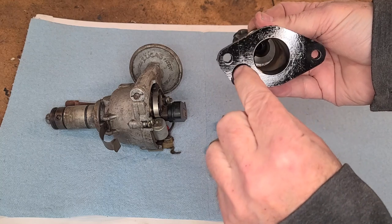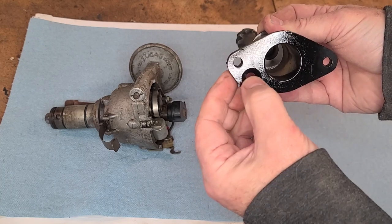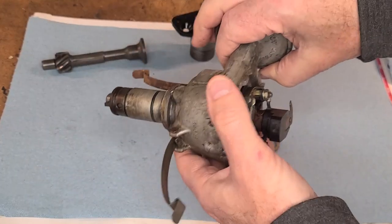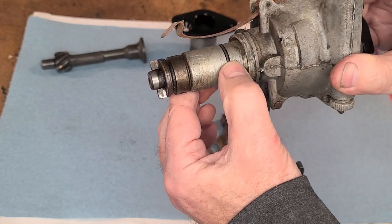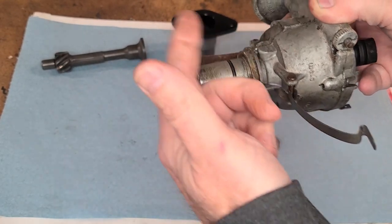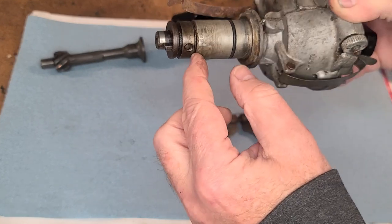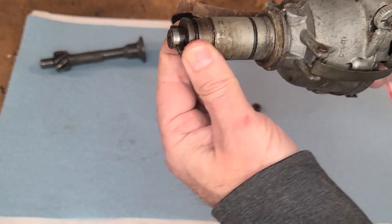I need to find a new bolt — this little flathead screw that goes in here got damaged and torqued. We're going to see if we can find a replacement. Now this distributor has a lot of things going on. First, these O-rings are shot — you can see they're flat, no longer rounded, so they don't seal anything. The idea behind the O-rings is to keep things lubricated while keeping the oil in the engine. This O-ring in here is degraded to almost nothing, so we're going to pull that out and get it replaced.